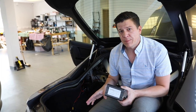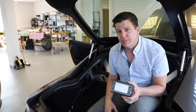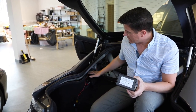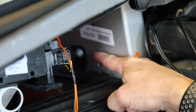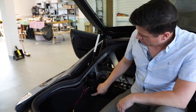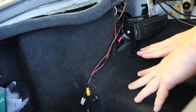To get the video from the cameras and CarPlay onto the factory navigation screen, we need to add an RGB interface. This is going to connect into where the nav module is. To get the nav module out, there are three 10mm bolts — one on the bottom right here and two on top. There is a trick to getting this out. Once you've removed those three 10mm bolts, you need to bring it out a bit and then push down here.